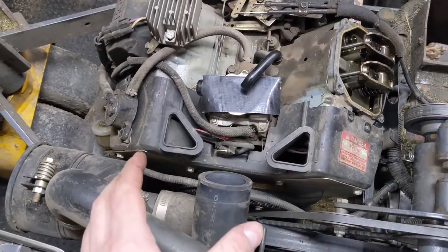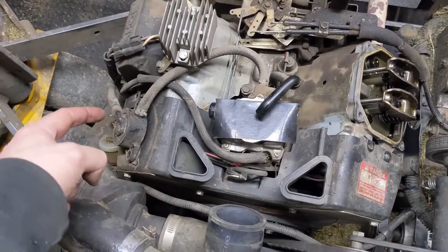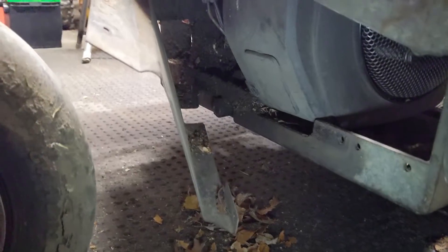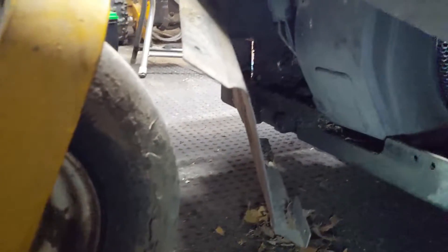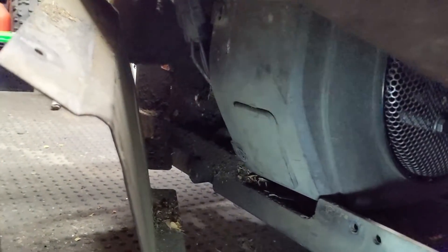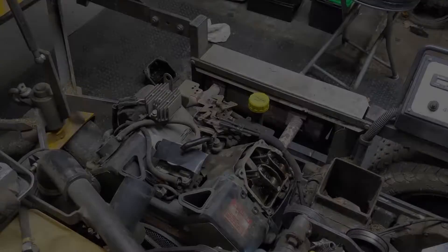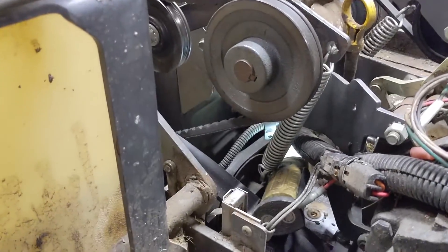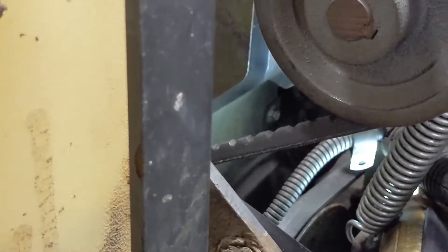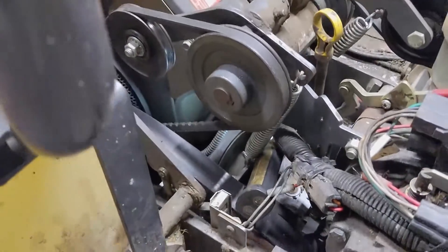On this whole front plastic cover there's two bolts here and two bolts over there, plus the fuel pump bolts. On the back side of the machine there's a skid plate that keeps dirt from the tires kicking up onto the engine, and there's two eight millimeter bolts on this side. Coming down around to the side from up top of the engine, the bolt in question is right in there — it's an eight millimeter bolt and there's hardly any room to get a ratchet in there.